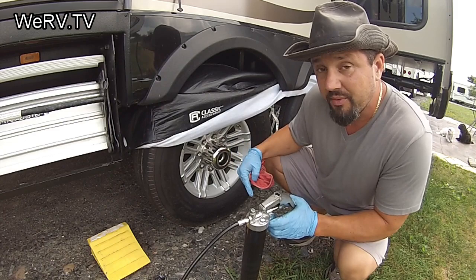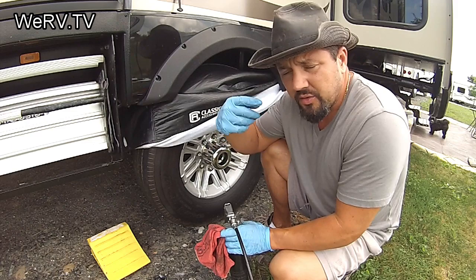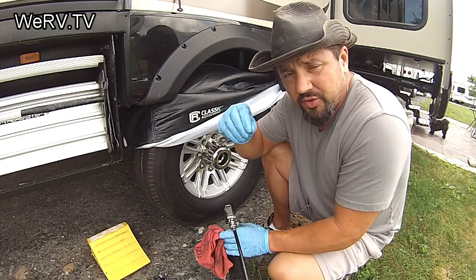In some cases if you overdo it, you actually have to take your whole wheel and drum off, clean your brakes, and put everything back together — you don't want that. If you're a full-timer who sits a lot, moisture can get into your bearings and pit them. They're stainless steel, but if they do pit and rust, water gets in and can make the bearing like sandpaper.